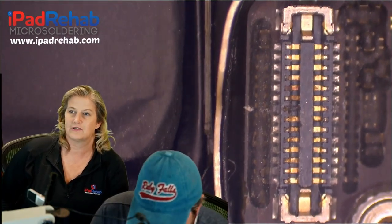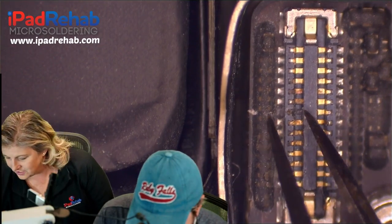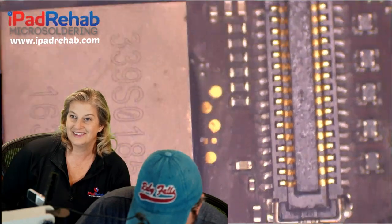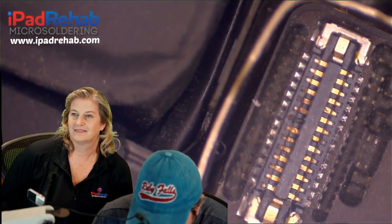So where are you going to find another pin? All these connectors are often a little bit different. That looks like an iPad mini LCD connector — I'll grab you one. See if the pin shape is the same. No, the pins are covered with plastic where it comes up and over — that section is wider. Definitely a little wider than that. Not going to work. How about the mini digitizer? That's definitely not it either.